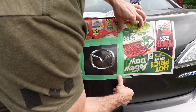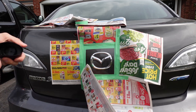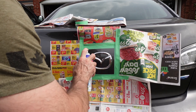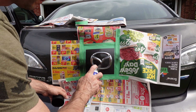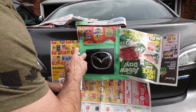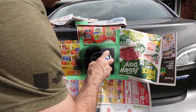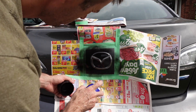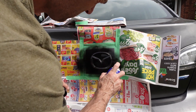Pretty easy to mask this thing off. You shake the can up for a while. If it was a cold day, you might want to put the can in warm water. Then I'm just going to go back and forth over the emblem, painting right onto the paint on the vehicle while I'm doing it, and I'll peel that off afterwards. I'm just using a sweeping motion and doing short bursts with the spray can, sweeping from one side and letting off the nozzle once I get to that far side.